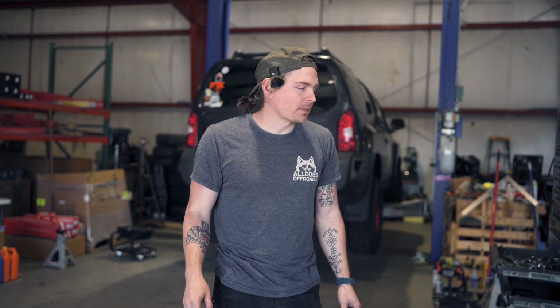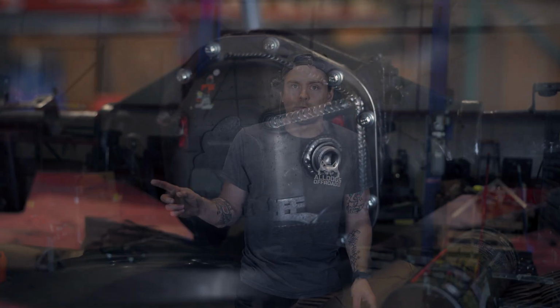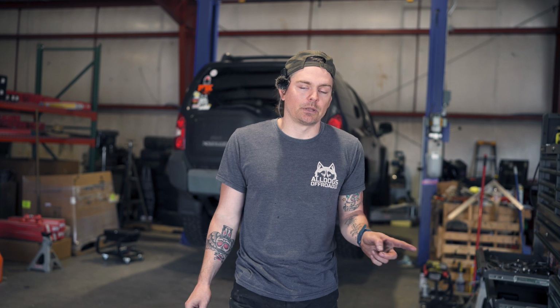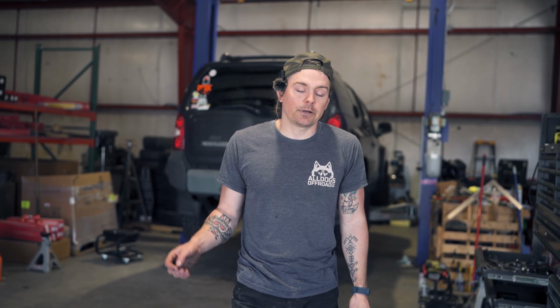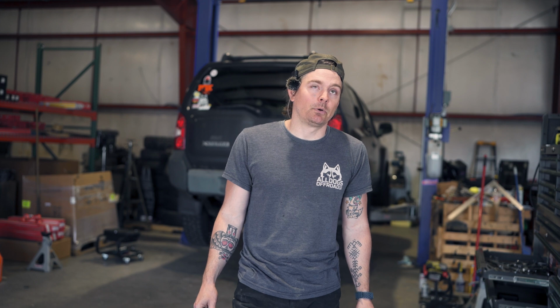A quick recap overall. We have a basic trim Xterra behind us, our shop Xterra. It's 313 geared right now with an R180A front diff and then a C200K rear diff. We're going to be swapping in an M226 with an E-locker in it, and then an R180A to the front that are 336 gear ratio. So we're going a little bit deeper, which will better match the tire size that we're running right now, and should effectively turn what was a 280,000 mile Xterra into, well, a brand new rear end.